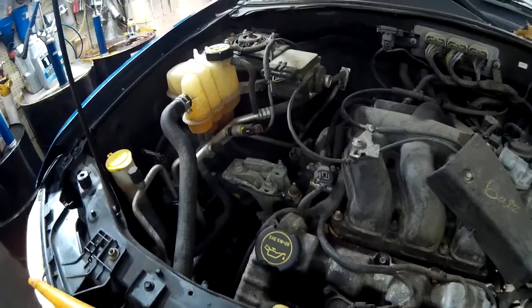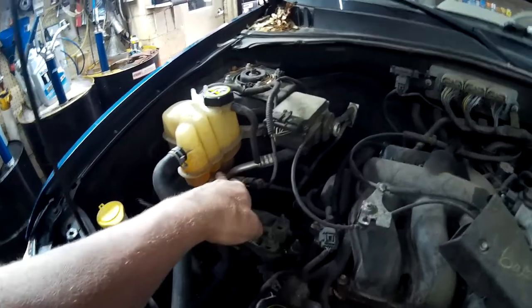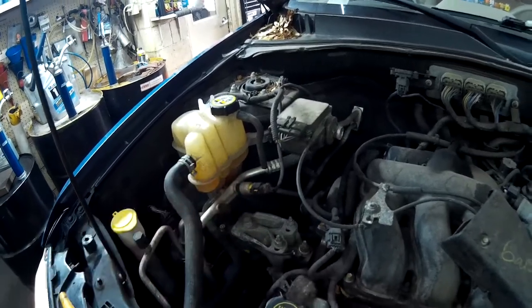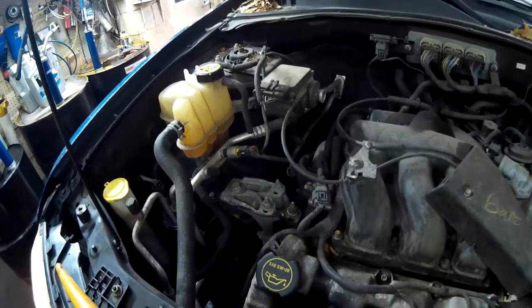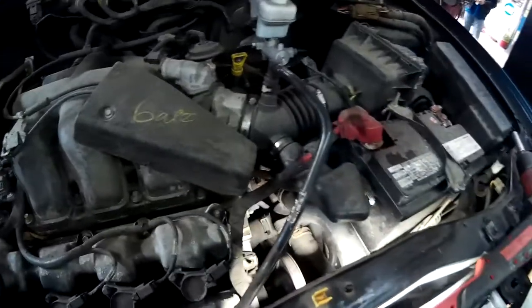This car holds two and a half gallons, so when you get about two and a quarter gallons, it's full. It takes a long time to fill the cooling system, so you just keep your funnel there, keep filling it up, keep purging it. Eventually the expansion tank will fill up and start spilling out, and that's when you know you have enough coolant in the system. Thanks for watching — here's your extra footage on the Escape radiator and how to fill the cooling system.